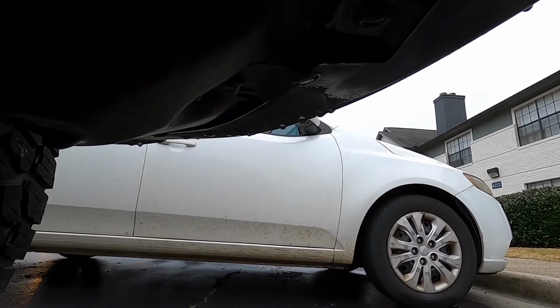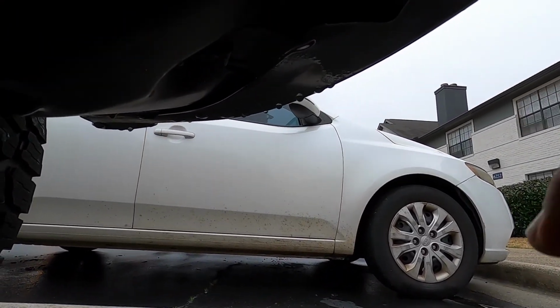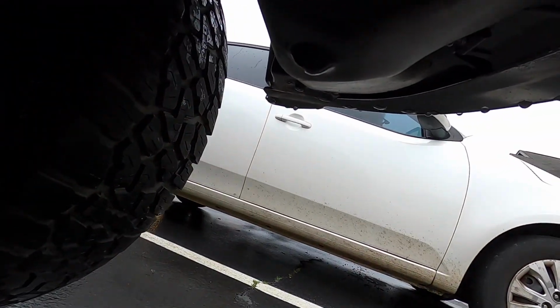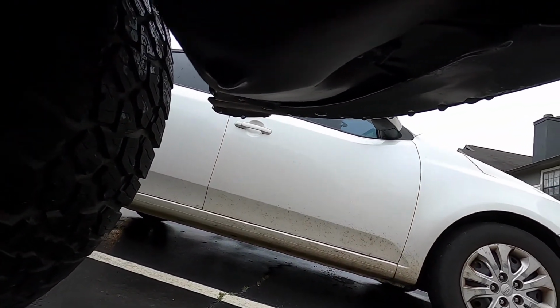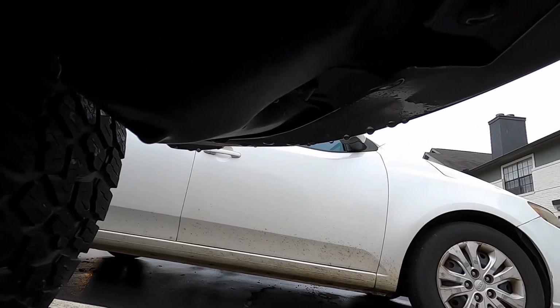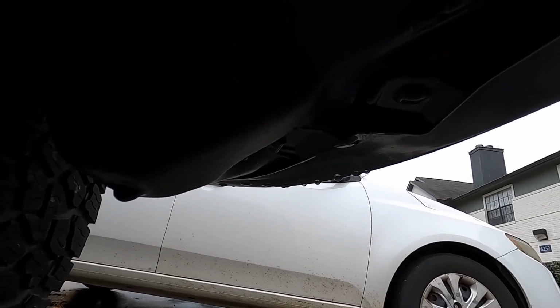All right, so I'm underneath the truck where the fog light housing is, and to put those in, there's only 3 10mm bolts. I'm at the driver's side tire trying to fight the storms, kind of raining. But we'll take these out, and then it should be easy access to the plug for the light. So once you release these bolts, then the plug should be right up there. We can twist it out right now,